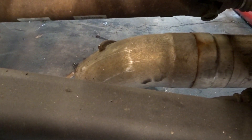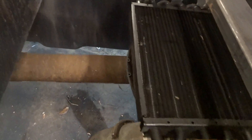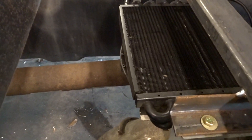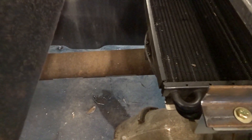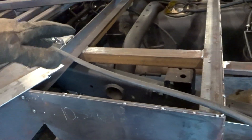Got that on — free downpipe. I was going to get one on Amazon for like 50 or 60 bucks, but I just cut a flange side off of this right here — good enough. It's either going to work really well or it's going to make the transmission entirely too hot. I don't think it will because honestly the trans runs a little cool at the moment anyway, so I think it'll work out about right. At least we've got the exhaust pointed down so it's not going back here and heating all this stuff up.